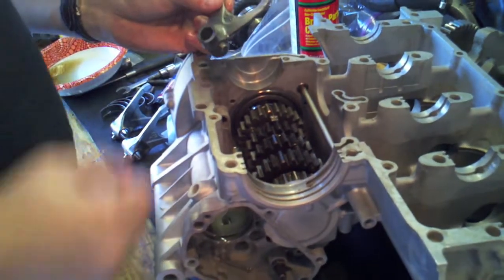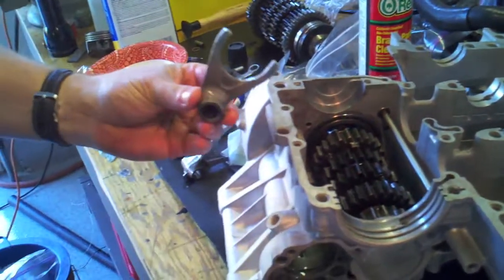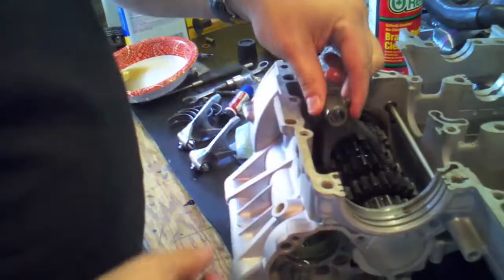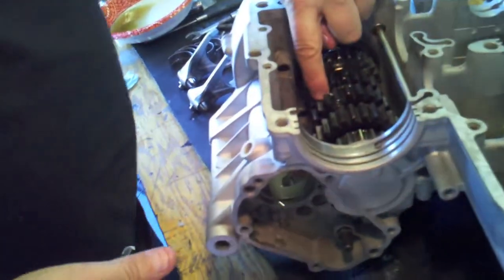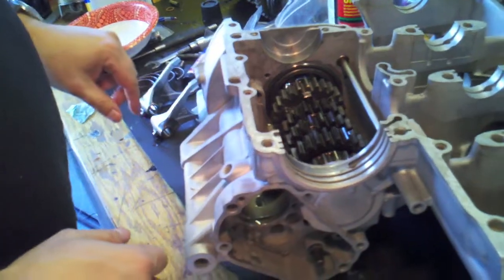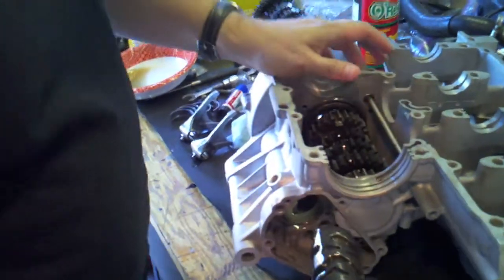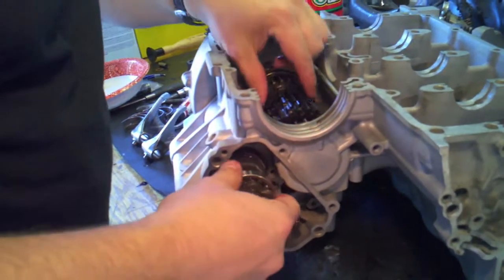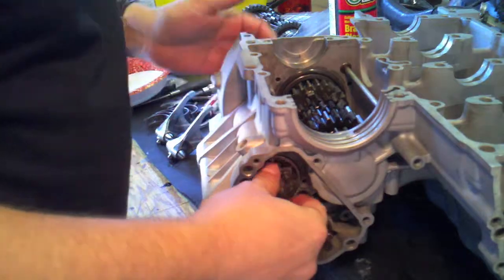The next step is shift fork C, which sits on the main axle assembly. The factory manual is pretty clear — it comes up from the bottom, so the little cam follower has to be oriented there. You can let it drop down into the bottom area and manipulate it later by holding the arm with your finger. With shift fork C in, you install the shift drum — oiled and cleaned up, it slides right into this opening. Shift fork C sits low enough not to get in the way, and this slides into a slot on the other side.